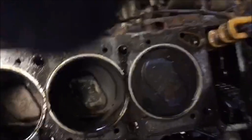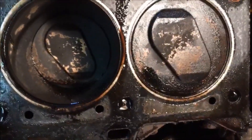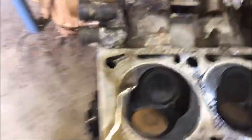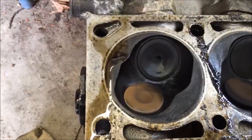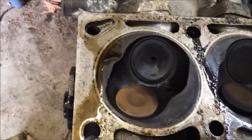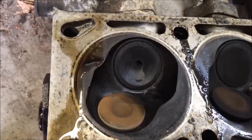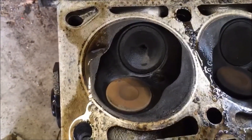Let's look at the engine. Let's get some light on this. Look at those 10-to-1 pistons. I don't see any evidence of contact. Very strange. I'm going to have to look into this a little bit more. There was absolutely no question that number one had low compression, like 25, and that when I did the leak-down test, all of the compression was escaping through the intake valve. Very odd. I will report back later. Rob out.